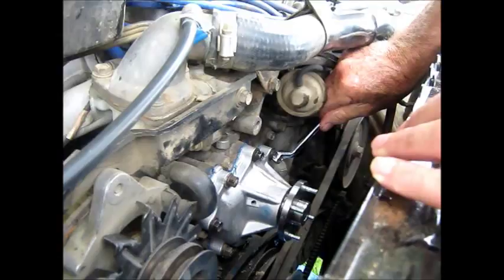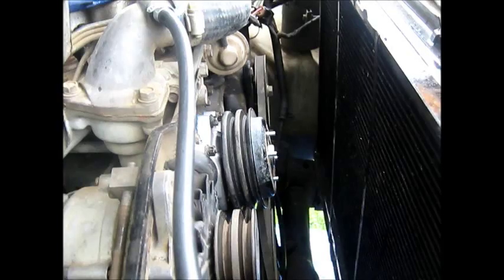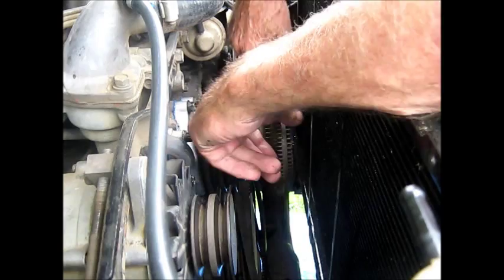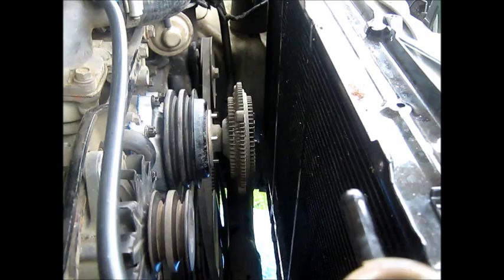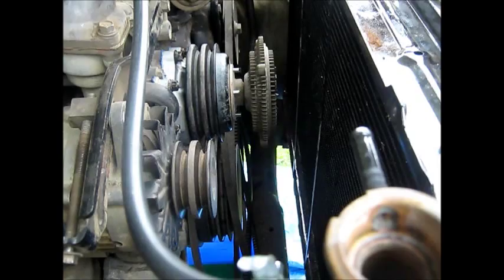We're putting these bits back on the water pump — that's the piece for the belts to go under. And that on there is the thermatic control, which goes on there. Then you put your bolts on, then put your fan back on, then put your belts on, and fill her up with coolant and see how it goes. Should be right then. This is the process here — not too easy either, I hope it's helping.